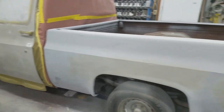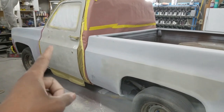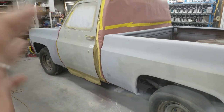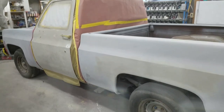If you don't have sealer you use more base coat - I've got plenty of base coat but I still don't want to push it. So I'm going to take the sealer and hit the doors because they're a different color primer than the rest of the truck. I guess I should have just primed the truck all in the same color primer, which was my plan until I ran out and had to switch halfway through.